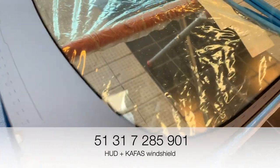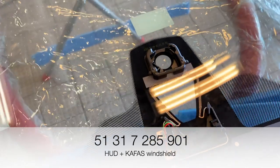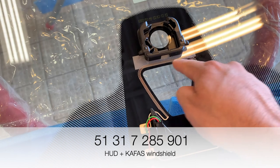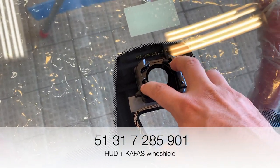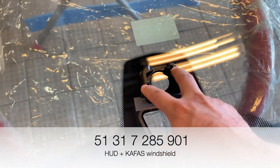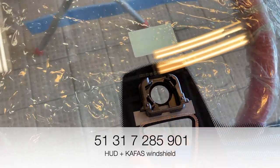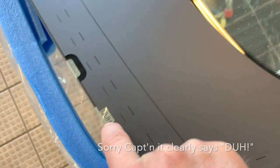This is the windshield that is going to go in the car. And we have the plugs for the heating element that goes around the camera. And we have the bracket that will hold the sensor here, which is for the dimming of the head-up display. And if you want to make sure that you got the right windshield, there's a tag at the bottom that says head-up display, so you know that it has the double coating.